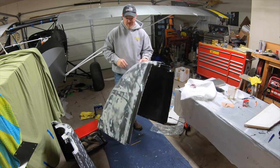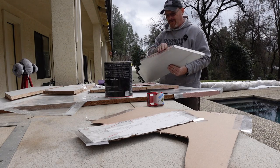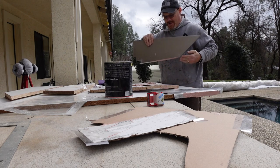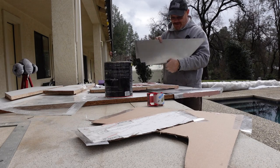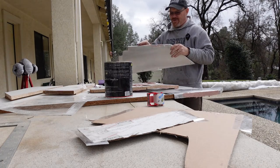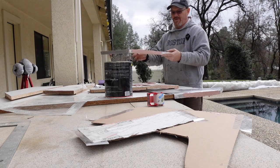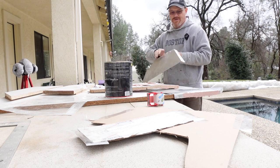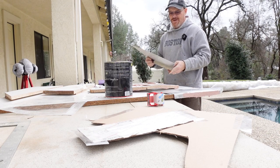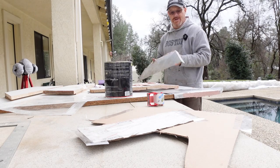The only thing left to modify is the bottom scoop to match the radiator — I won't get to that until probably next week. What I'm doing now is taking these kick panels for the console and putting a little bit of Bondo on the bottom so they sit flush. The floor's got just a little bit of a bow to it and these don't sit flush; the aluminum ones have never sat flush. So I'm adding a little curvature to the bottom, going to sand it out and finish it off nice, then use this for the template. I've got some wood to make a mold out of it, and then we're going to lay three layers of carbon up over the top. I'll get the body work done, then paint it with a PVA so the carbon will release. I've got all the carbon cut and ready to put the resin in and lay down.